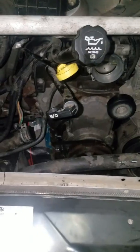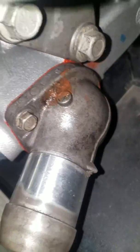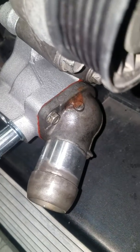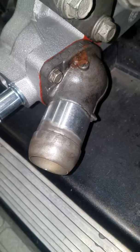A quick note on the thermostat — if all you're doing is replacing the thermostat, the only thing you've got to pull off is the reservoir overflow bottle. You'll be able to reach down on the side and take the two 10 millimeter bolts off the housing. Just be patient, you'll be able to get them out and replace the thermostat — you don't have to take the belt off. You will have to change the antifreeze though, because all the antifreeze will come out.